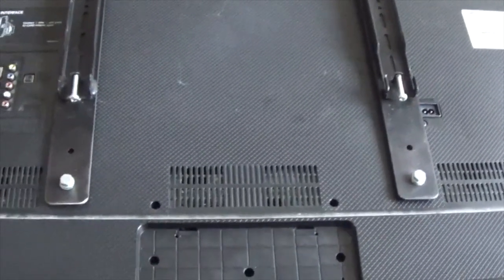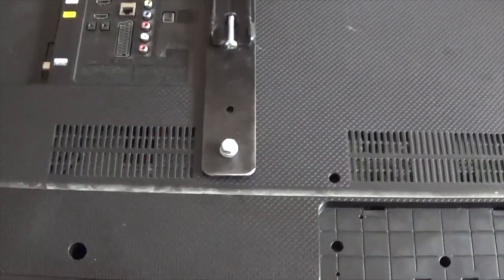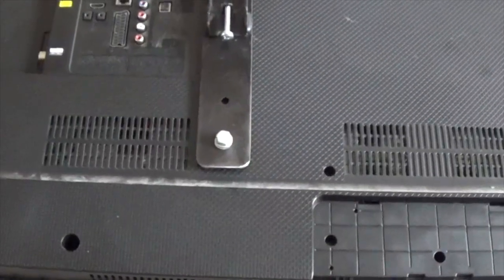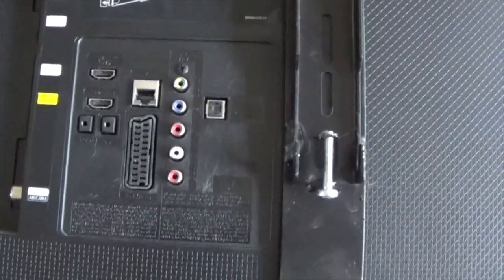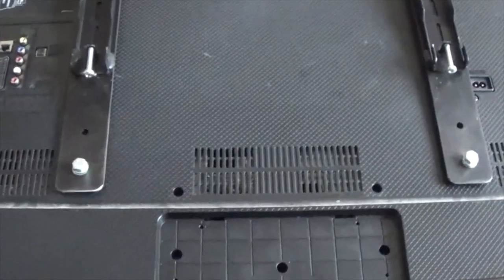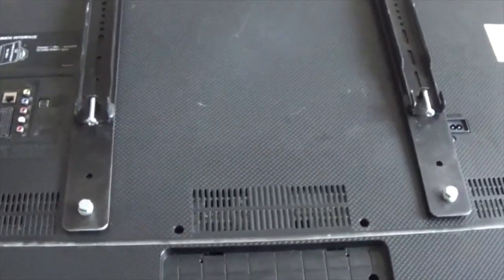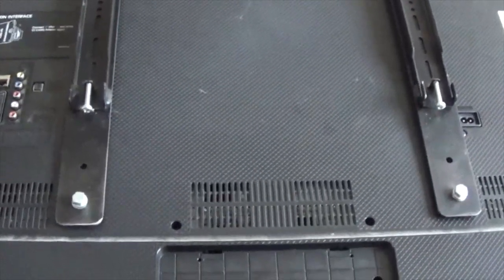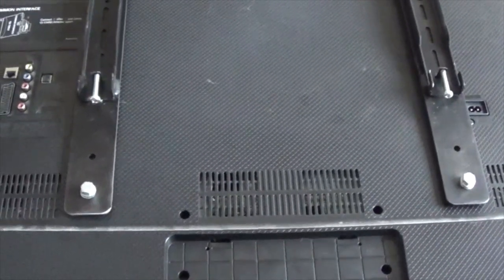So it's either overheating, the capacitors are leaking, or another fault. This TV is just over two years old - maybe two and a half years old now. It's still a relatively new TV, it's a smart 3D TV. I'll put the model number in the description. I've already bought a replacement mainboard for it, as that seems to be a common failure.